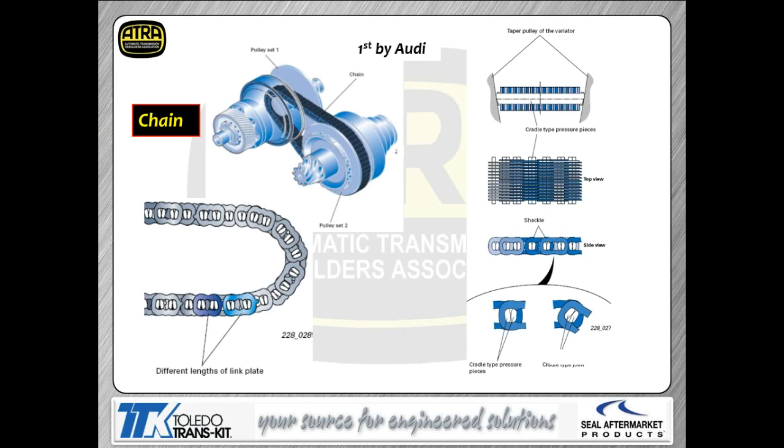The other thing you're going to probably notice is the pinion is actually attached to that pulley mechanism right there. As I talked about earlier, you have a couple different choices. You can take a link out of the chain and take it out one piece at a time, or you can press the pinion shaft out with the Porta Power and then take everything as you see out of the transmission there per se.